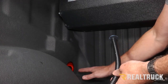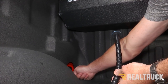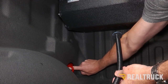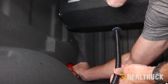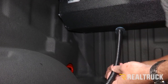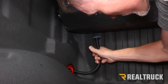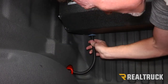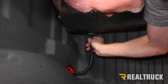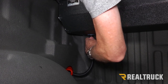There are a number of places to run the drain tube. You can fish it down in between the bed and the liner, or if your truck doesn't have a drop-in liner you can pop out the little plug, run the drain tube through that hole, and snap it in place. Once you hear it click twice, it's installed. Do that on the opposite side as well.